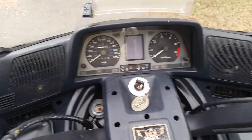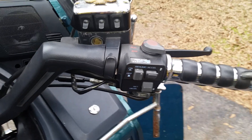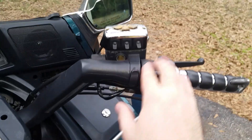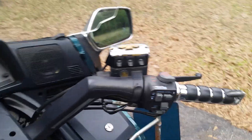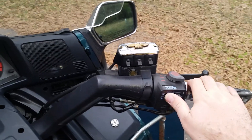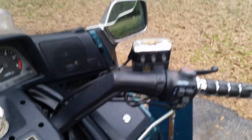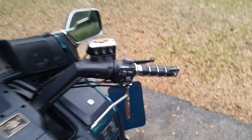This is like a little mini car — it's even got cruise control on it. I haven't been able to get it working yet and will probably end up replacing it. I already replaced the vacuum actuator and that didn't do any good. The outside buttons are corroded and sticky from sitting. The replacement switch is an aftermarket piece you can buy at Gold Wing Supplies, and it's not cheap.